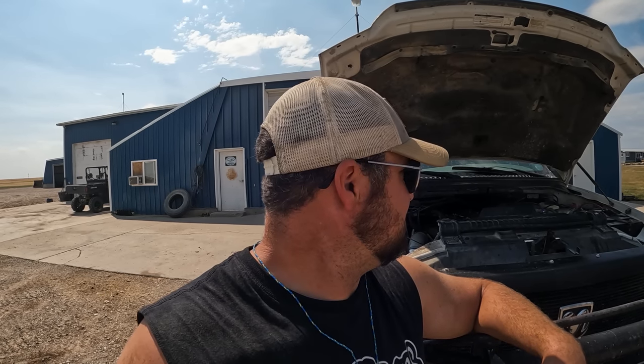So saying that, this 12 valve Cummins, gonna have to get looked at. And while the guys are out there working, they're harvesting, the trucks are taking forever to fill up, it's gonna be a couple hours before they need me, I might as well start looking at this thing and figuring out what is going on. And maybe we can fix it. If it's just a bent valve and nothing happened to the piston, I can send the head off someplace and they can put new seals in it, new valves and springs, and make sure everything looks good. Get a head gasket, put it back on this thing, and this thing will be fine. Or we'll have to pull the motor and we might have to rebuild it.